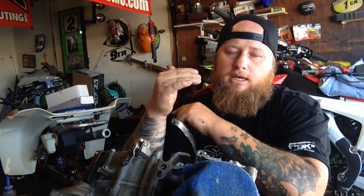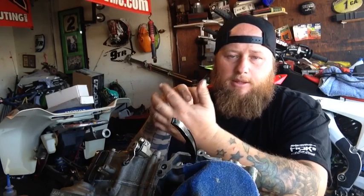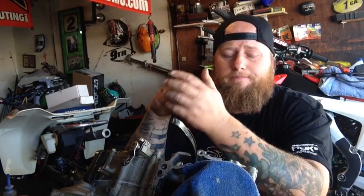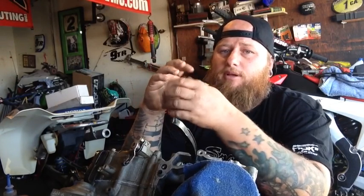I would say for an amateur engine builder, someone that's doing it themselves and maybe doesn't have access to a machine shop, what he's talking about is that every time you replace a valve inside the head, there are three distinct angles that a machinist would cut into the valve seats. And I know for sure that you're not supposed to use any valve lapping compound like you would in an automotive application. With motorcycles, the valves we're dealing with are titanium, coated valves of that sort, and it's actually worse if you use any lapping compound to lap the valves to the new valve seats.